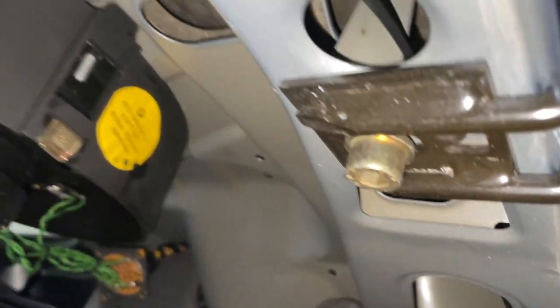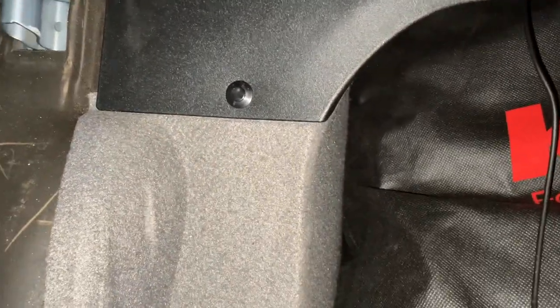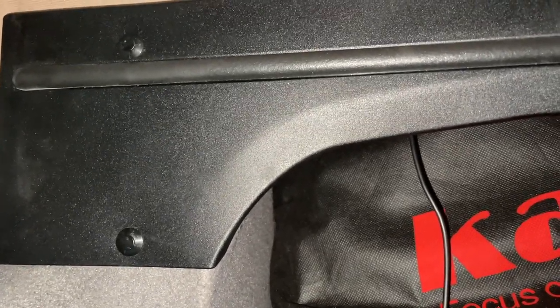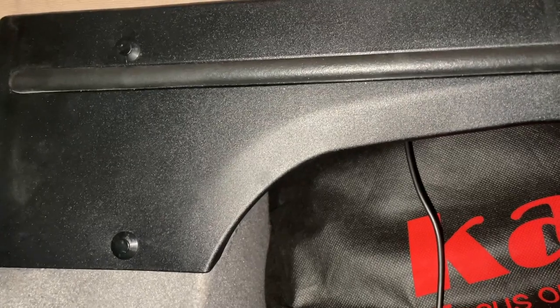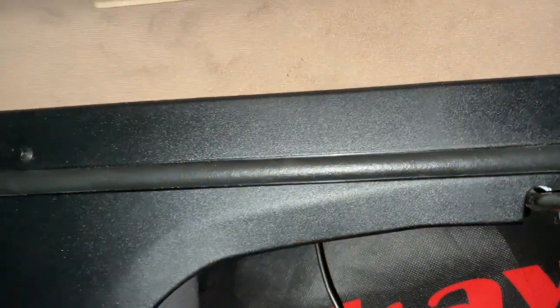So far, as you can see, we've kind of got this tidied up, but we've got the wire traveling all the way through these little holes in the part of the chassis of the car, and then go right over here. And I have to remove this little trim piece over here, just like we did on that side. Same exact clips, just a different time again over here. We're going to flip this whole gray carpeting forward so we can swap the wires all the way down towards the battery of the car, which is also next to the taillight. And over there, we can then power the camera with the reverse tail, like I mentioned earlier, and we can also run the RCA cable up to the camera, which will be in the trunk lid through that little grommet.